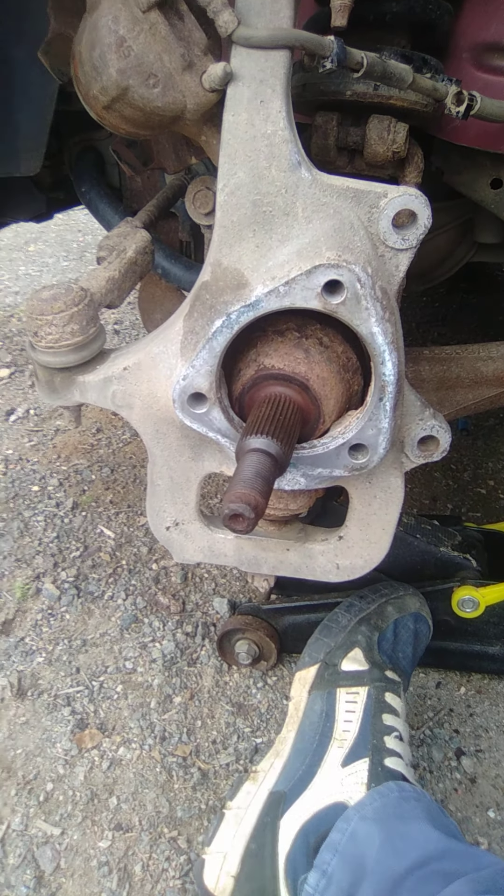Anyway, thanks for watching folks. I'm going to put this all together. As you can see, it's only three bolts — a backing plate, your speed sensor, your rotor, and your brakes. Don't be intimidated by this. Use a little bit of grease. You do need a little bit of power to take that axle nut off — it's torqued to 100 pounds, and after sitting there for a long time it's probably way more than 100 pounds to pull off. But eat your Wheaties in the morning and you'll be able to do it. See you later folks!